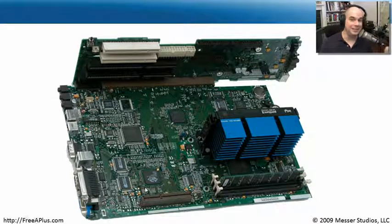It was something that was very standardized. So if you happen to see this motherboard, you'll notice immediately it's an NLX because of the extra daughter card, the motherboard having this big connection to it, and the AGP built right onto the motherboard itself — very different from the ATX or BTX motherboards we looked at earlier.